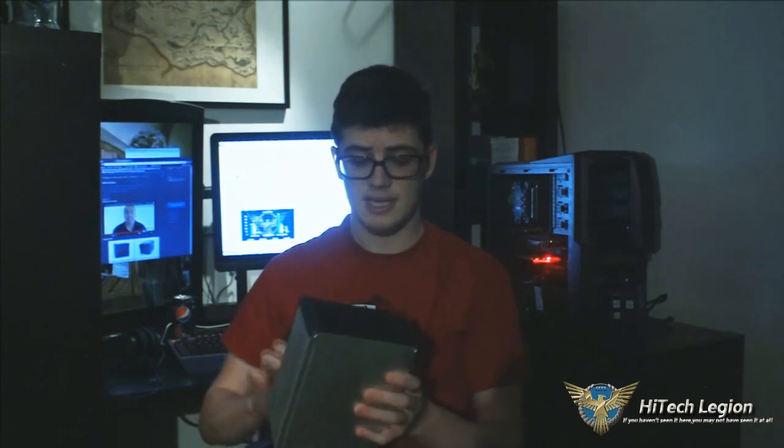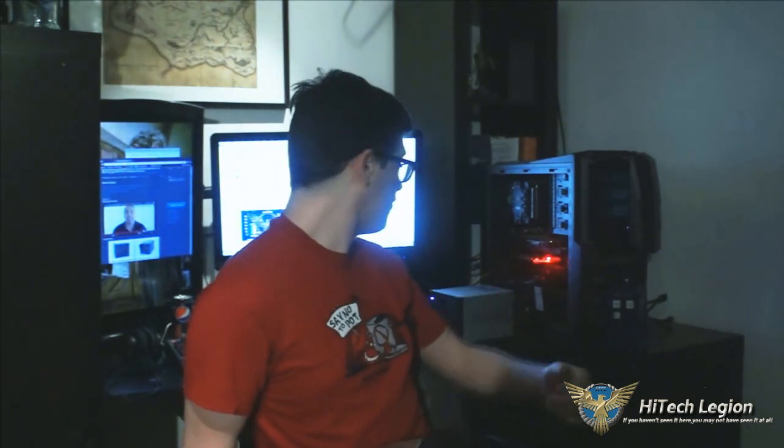There was no real performance hit to using it rather than connecting directly to the motherboard as expected. These performed really, really well and the build quality is superb — the doors are very solid and I'm not worried about these breaking at all. What I would recommend using these for is a file server, a media server in your home, or a regular file server for a small office. You just put one in any PC and you can run three drives, or four with the larger unit, plus the added USB 3 on the front with LED indicators to show when a drive is in use.